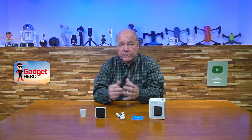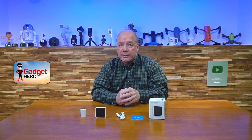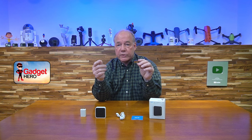As far as the Sync Module 2 goes, this USB-A port on the side will support any external USB thumb drive up to 256 GB in capacity — anything over that it can't recognize. You also want to make sure any thumb drive you install has at least 350 MB of free space on it, and that it's formatted. It has to be formatted when it goes in, or you can format it in the unit through the application.